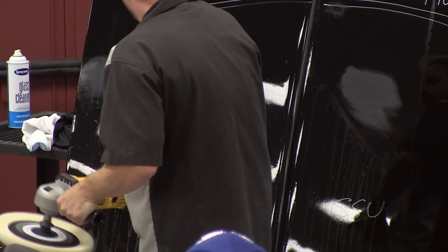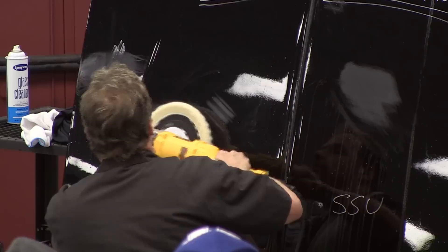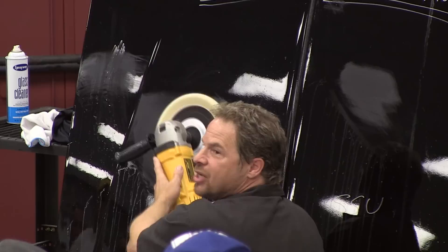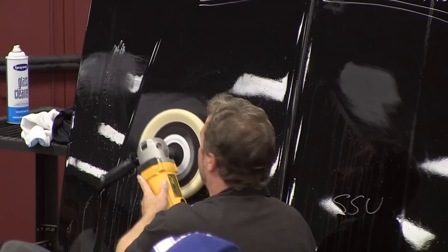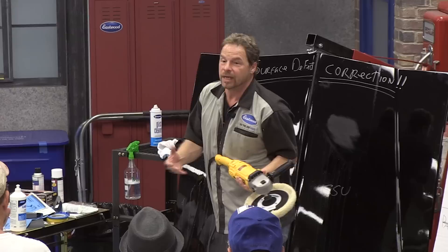I'll start off with a low speed. Typically this panel is going to be flat, but it's not flat, which is good because I'm not going to sling compound all over you. I'm just going to gently rub it in. I'm at 600 RPM. I'm not fighting this technology, I'm not fighting the equipment — I'm floating the pad on the panel. I don't even have to look at it. I know I'm not going to pull an edge off. It's one hand, and it's not jumping all over the place. I've got one edge slightly lifted and it just sort of floats over the panel. This thing's heavy — let the equipment do the job.